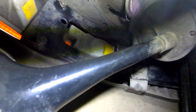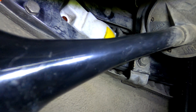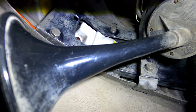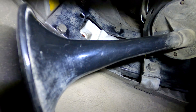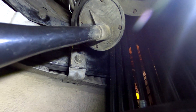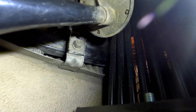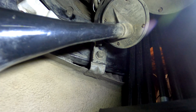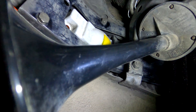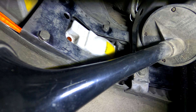In order to get access to the bolts to remove the light housing, you need to first remove that plate. There are four bolts — two on one side, two more on the other — and you can use a 13mm socket or wrench to take those off. Once you take those off, the plate will come loose and you can fish the plate out from the bumper, either by the front near the horns or through the back between the oil cooler and the accordion toward the tire. Either way it's very easy to remove. Then slide the plate out of the way and you'll see both bolts for the light housing.